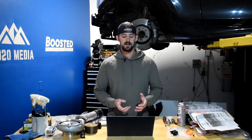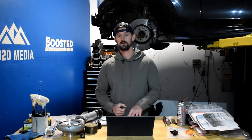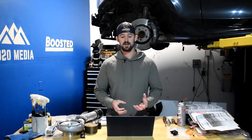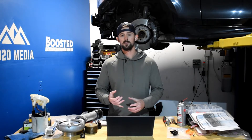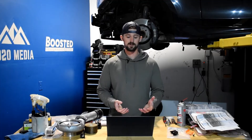The fourth modification on our list is an intake horn. The stock intake horn is relatively small and restrictive — it's only about 2.4 inches in diameter. A popular upgrade is buying an aftermarket intake horn; most of them come in 3.5-inch configurations. This significantly increases the amount of airflow going through the intake and into the intake manifold, improving air inflow in addition to an intake and providing modest power gains. The biggest benefit, again, is efficiently bringing more air into the engine to help the turbocharger's efficiency.